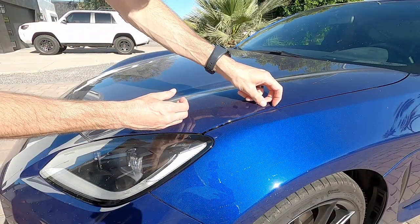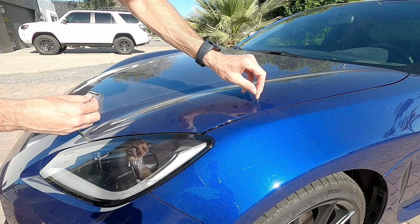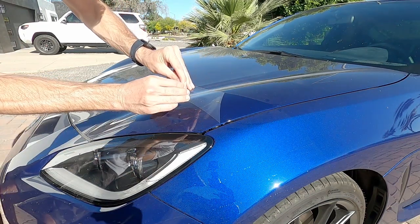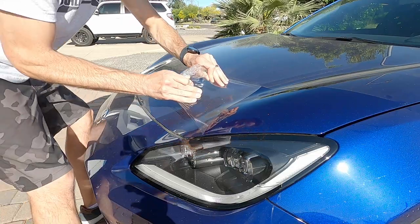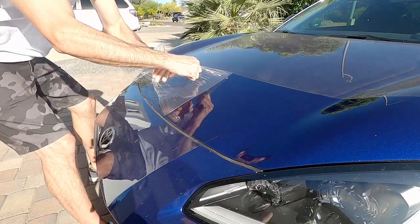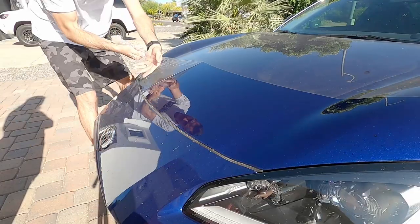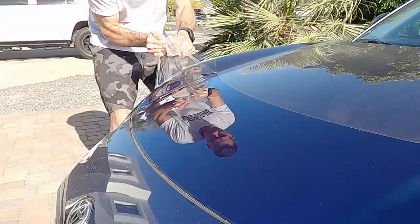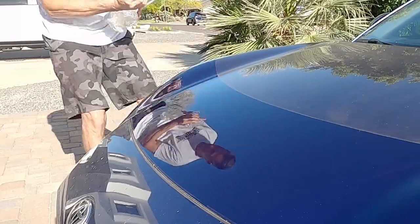Obviously the car was very dirty so it was easy to see. After letting the car sit out in the hot sunshine for a good hour or two, we're able to peel this stuff right off. Simply grab it from the corner, start pulling away, and slowly it'll start making its way up. You can do this for pretty much every part of the car that has the factory PPF. This stuff is not super high quality — it's like a $250 option from the factory, and the installation shows for the cost. Looks bad, and eventually you're going to have discoloration in the paint where the PPF is installed and where no PPF is installed.